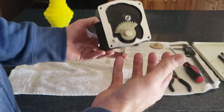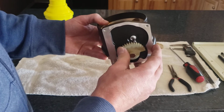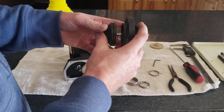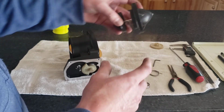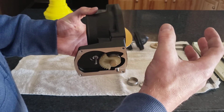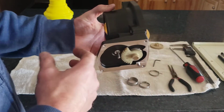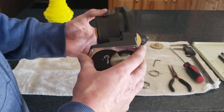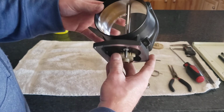And then I will just need to control this guy with my Arduino. So I need to figure out how to send it the right messages. Essentially the Arduino will be looking at the pressure differential, just like this valve would be seeing, except the Arduino will be looking at a pressure differential sensor, essentially two MAP sensors on either side of the body. And when it sees that the pressure on the outlet side of the valve is significantly lower than the pressure on the inlet side of the valve, plus it'll rely on knowing when the eBoosters are actually being commanded to boost, those two conditions will drive this valve to close.